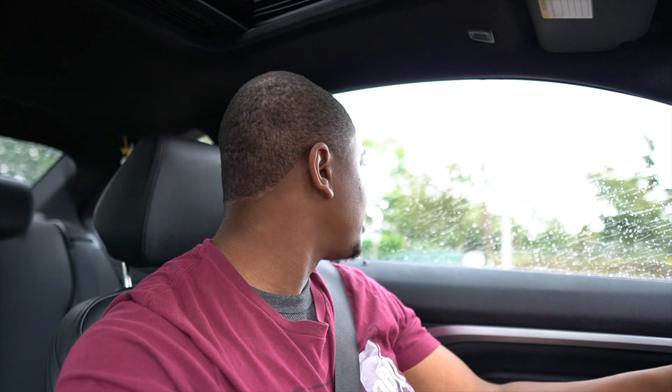That may be a trade-off for less dust, and it's not a trade-off that I like. I'll keep driving on these — hopefully they'll get better. If they do, I'll keep them, but I can't really keep brakes on this car that I'm not a fan of because of how I drive. I need to be able to stop when I need to. I'll report back to you guys. OEM-wise, if you're doing normal driving and even some high-speed stuff, you should be good. But track-wise and driving like a complete maniac, I don't know if I'd recommend these. The OEM brakes had better fade characteristics — these seem to fade out a lot quicker.